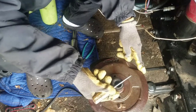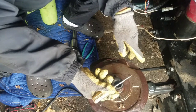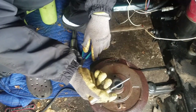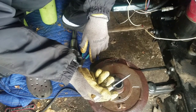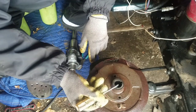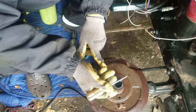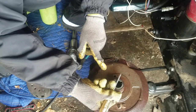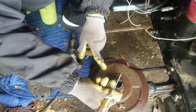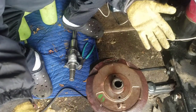I've actually seen, if you pull up most of the schematics for this engine, or what I believe this engine is, 31R707-0033, 1G in the serial number, right? If you look at the schematics, there comes a flywheel that has a part number. That part number, when you search it on eBay or Amazon or whatever, is another flywheel that looks just like this, except the keyway is not at 2 o'clock, but rather 1 o'clock, like that. So I think that if I got that one, it might work. Problem is, there's only one available on eBay, and it's $180. Oh, you know me. I don't spend $180 for nothing. Nothing!